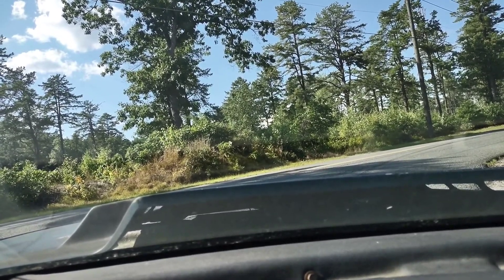A lot better — sorry about the shakiness. Before, right around 3500 RPMs it used to just kind of fall on its face and really not make any power. So I thought I was just running lean on the top end, like I thought my jets were a little funky or something in that nature. But I did a little research on it and they were saying that valve float could possibly be an issue. So we're gonna make a quick trip down to Mexico to test on her a little bit and see how much of a difference this valve job has made.